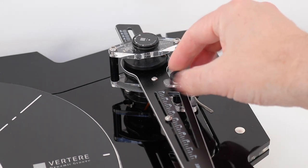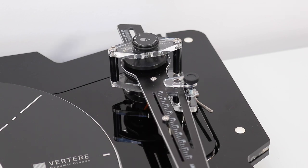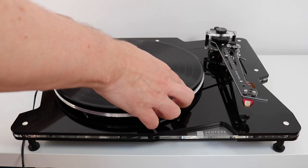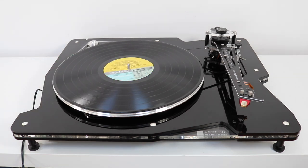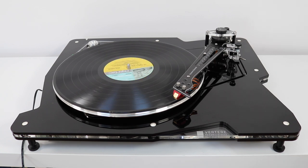On the arm itself is a transport screw, and when you remove it you can see that the arm moves freely — too freely, because there's no restraining clip. So you'll end up using the transport screw again just to keep the arm in place during operation. When I'm about to play a record, undoing that transport screw releases the arm, and you can see how it just moves almost of its own accord — it never feels fully secure where it sits. It really needs that transport screw to keep the arm in place to safeguard against accidental knocks. I would have preferred to see a restraining clip of some sort; using a transport screw is a little bit clunky.